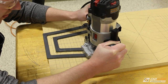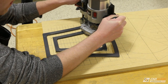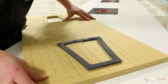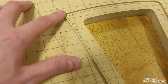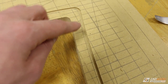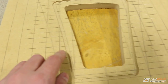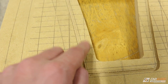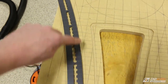Keep in mind, you don't necessarily have to have templates to use these router bushings — you could use a scrap piece of wood, cut a sweeping arc on it with a jigsaw, and then copy that onto your panel. Once I'm done making that cutting pass with the router, you can see I've created this groove. Next, I'm using a flush trim bit to flush trim the inside of the shape and remove it from the panel. By using the router bushing and the template guide system, I've created this groove that goes around that perfect shape. I'm going to use this to create an accent line in the carpet material when I go to wrap this panel. The different sizes of straight bits are included so you can create a different width of cut depending on the materials — if doing a vinyl-to-vinyl transition, you would use only the 1/8 inch cut rather than the full 3/16 inch. I'm now going to repeat that step using the arc template on this line we drew earlier.